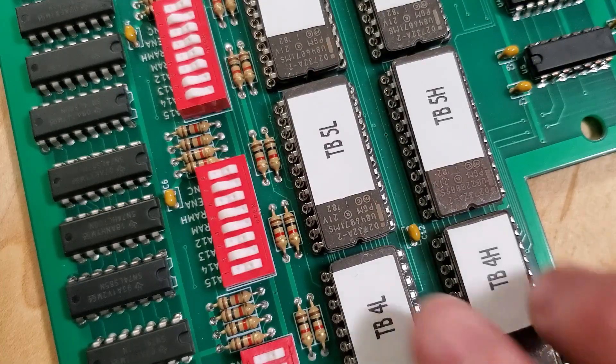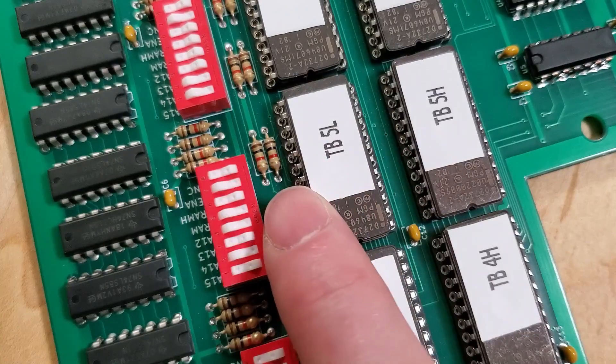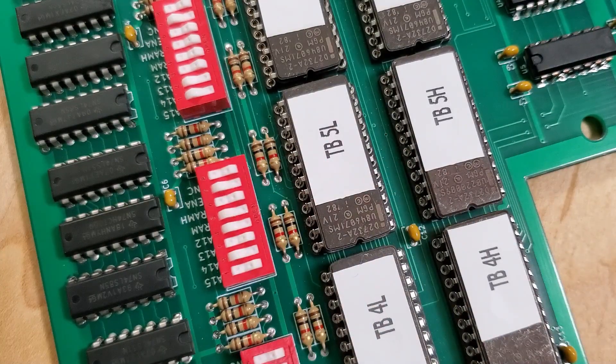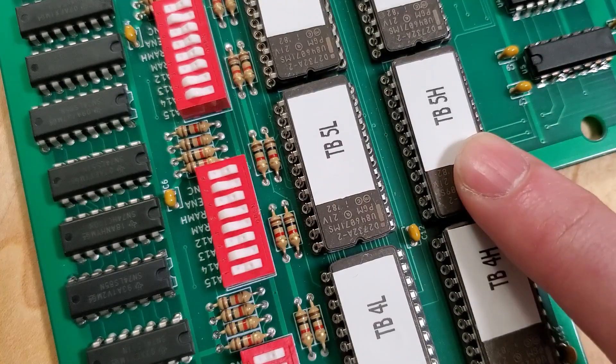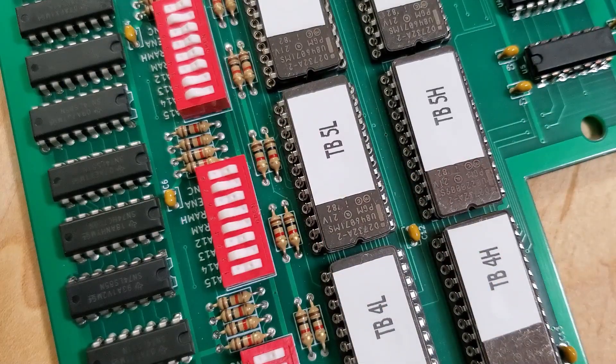These two sockets hold either RAM chips or ROM chips. They are typically installed as matching pairs of 8-bit wide ROM or 8-bit wide RAM to handle the full 16-bit width of the Intellivision bus. This chip holds the high 8 bits, and this chip holds the low 8 bits. If only one chip of the pair is installed, such as only needing 8-bit wide RAM, then one chip is installed in the lower socket for the lower RAM bits. The max size supported by each socket is 4-kilobyte ROM chips or 2-kilobyte RAM chips.